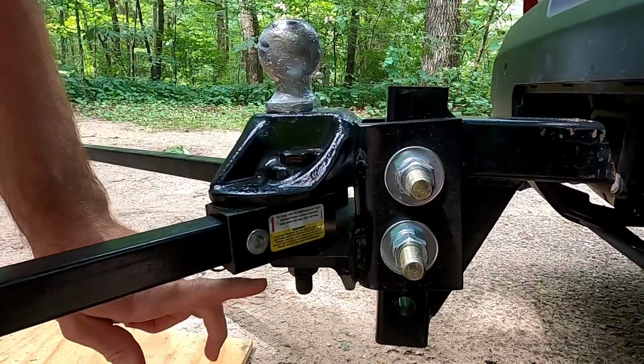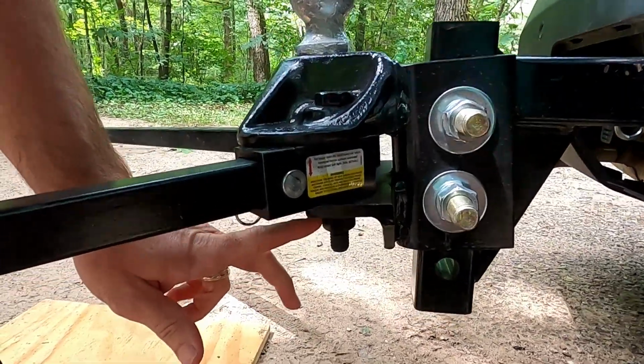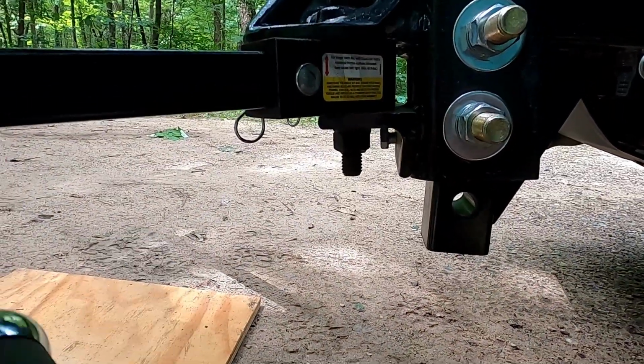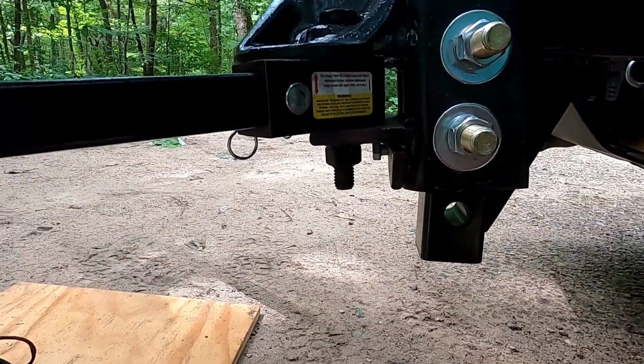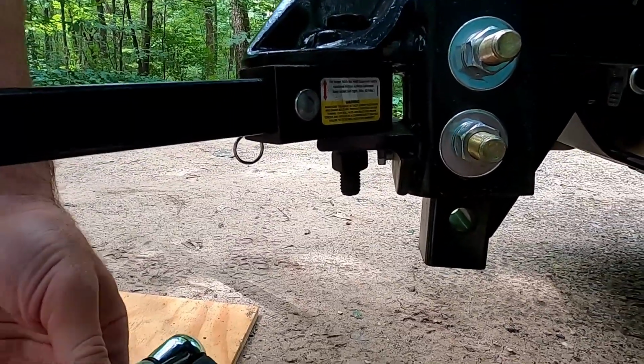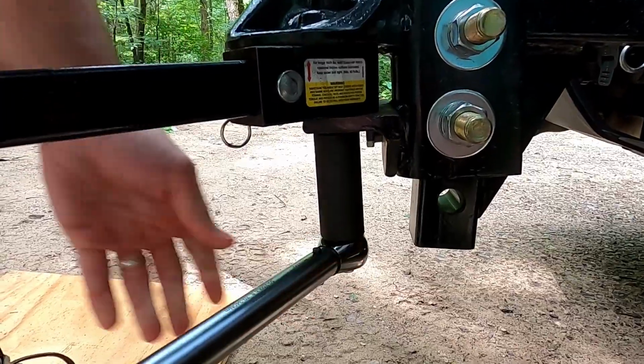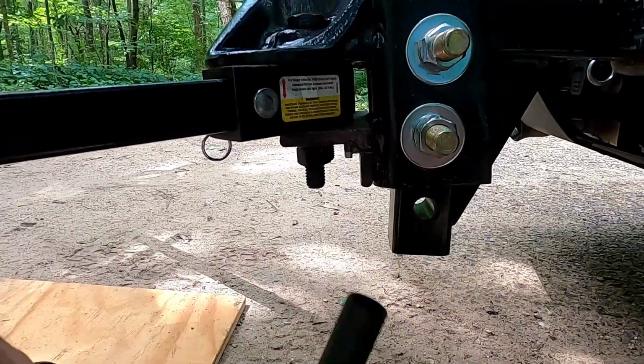The other thing I torque is the socket bolts. So these are the two bolts for the two arms, and it actually takes the 24 millimeter socket that I have, and I do a deep socket for this as well, and I'll just tighten these up each time as well on each side.